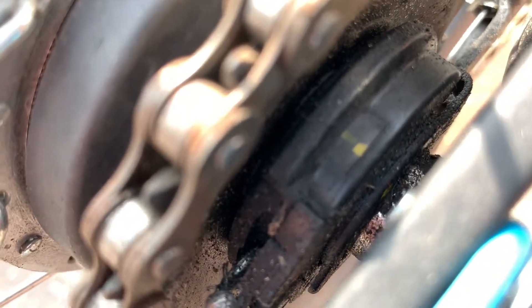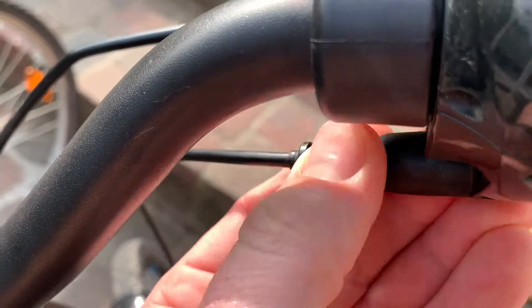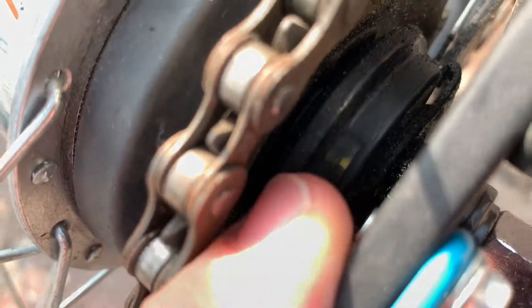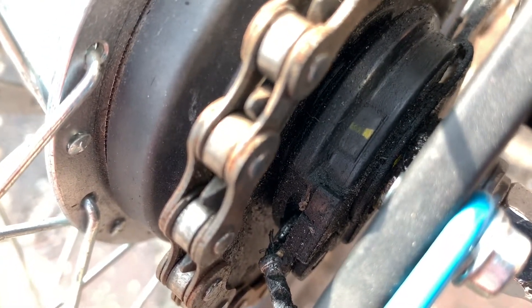Let's have a look at the back side. Do the two lines match? Oh, nearly — maybe one little adjustment is needed. Let's go back to the front side and rotate another 360 degrees with this adjustment knob. And now — yeah, there it is! One line. That is enough. Now your Shimano Nexus Inter 8 gear box setup is done.